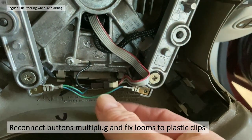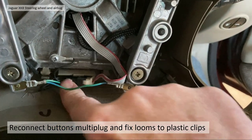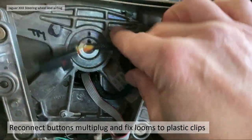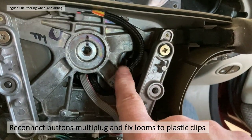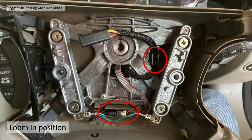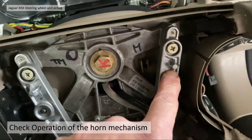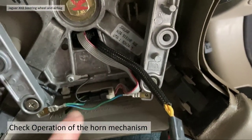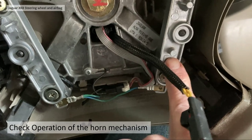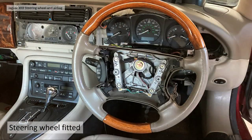These connectors have a little clip position — push them into that clip. The airbag wiring loom is quite long and there's a little clip on the right-hand side for it — a bit fiddly but you can get it in. Once done, both looms should be neatly clipped away so they won't rattle. Before putting the airbag on, just check the operation of the horn mechanism and the two clips to make sure the wiring is all still connected — that ensures the horn will work once the airbag is fitted.